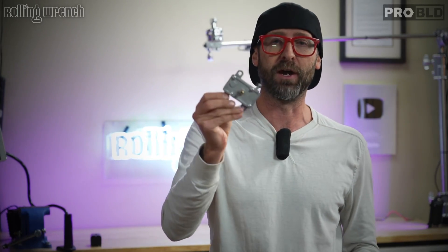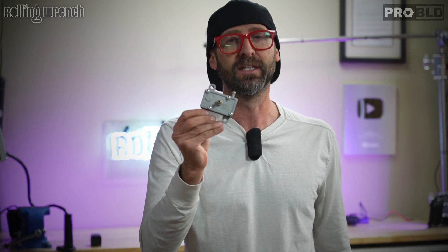Say you haven't ridden your GY6 motorcycle, scooter, ATV, or Ruckus in about two weeks. You turn the key on, the battery's completely charged, and you crank and crank and crank — maybe it starts, or it doesn't, and your battery dies. Or you have to spray starter fluid or ether into the carburetor intake every time after sitting. Maybe you even pop the gas cap off and blow into it to get gas flowing. All of this results from this super unreliable part: the vacuum-operated fuel pump.